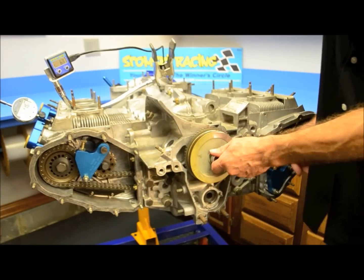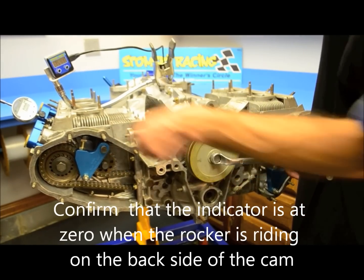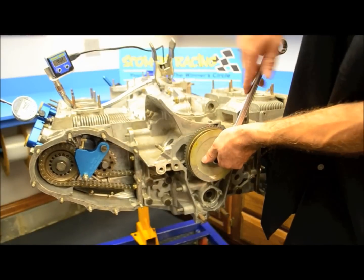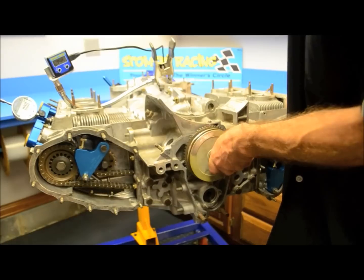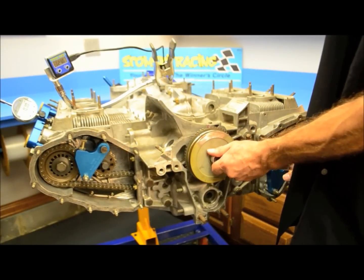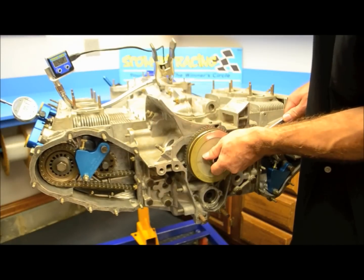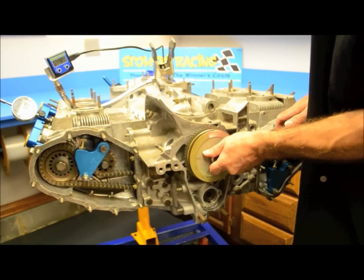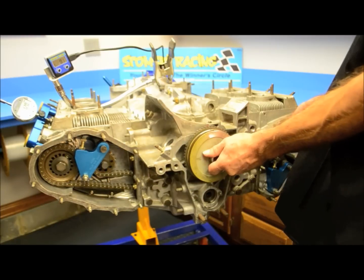Now we're going to go through the phasing one more time. Spin around, make sure we're zeroed out — and we are. Now, watching the digital degree wheel come up: we're at 250 degrees, 300 degrees, about 320 — we're starting to come on cam here. I'm going to nudge up to 360. Watching — we're at 350. Dead on. Zero degrees on our digital degree wheel, and at 1.2mm, which is well within our range of 1.1 to 1.4.